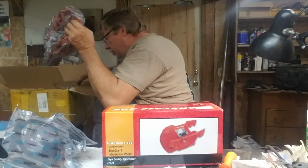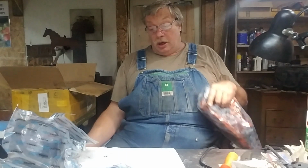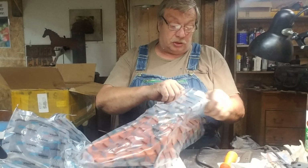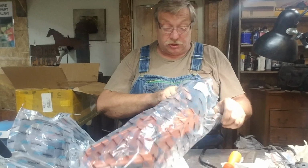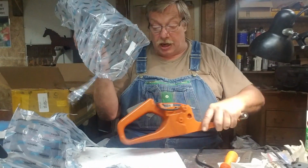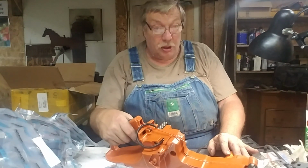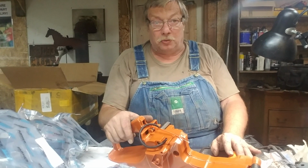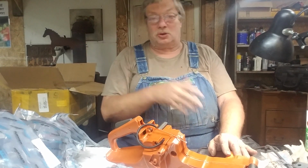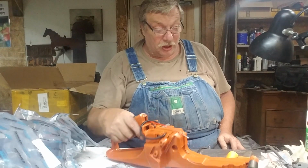I'll tell you what I've had a problem with in the past on these. I built 2 or 3 of these, and I've got 2 of them that I built 2 or 3 years ago out there in loggers' hands. I said try it, test it, by replacing the crank and the bearings and the seals and doing the necessary internal stuff. I told them things are going to break, just bring it back, we'll put OEM in it. Well, we ended up doing a clutch on one, the other one we ended up with ignition, and of course that ignition failed right away. Found out what he was doing, cutting in the winter. Saw's hotter than heck, he tripped and fell on the snowbank, and that cold snow came right in that starter cover and fried the ignition. It chilled down too quick. It's the only thing we could figure.